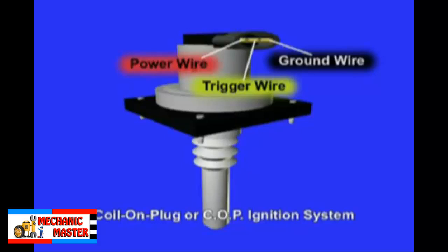Check wires and spark plug boots for coolant or oil-soaked conditions and replace them if these conditions exist. Check spark plug wire terminals for signs of corrosion or arcing at both ends of the wire.